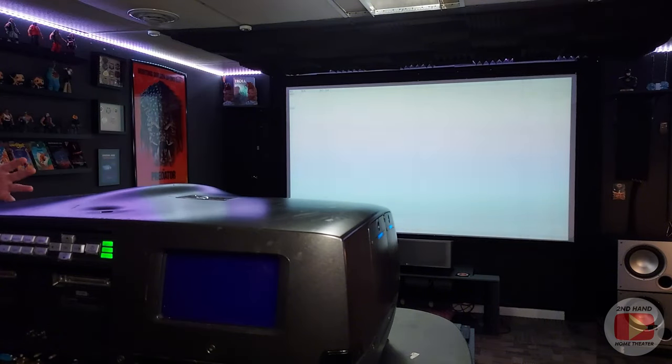We're looking to make sure all four sides are completely square. We've pretty much got the horizontal now. So if I was to pull the image to the left or right with the lens shift without actually moving the projector, if you look as I move it to the left, it should by all accounts perfectly match up with the side of the screen here. But if you notice — if I pull my little makeshift curtain away — this top end of the projector is slightly out further than the bottom. You can see the bottom on the camera is slightly in a little bit.